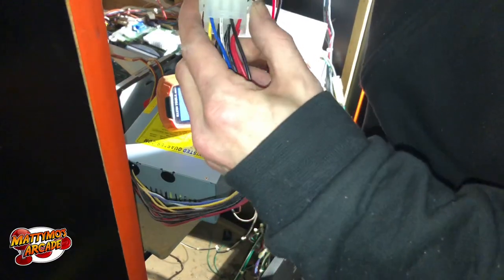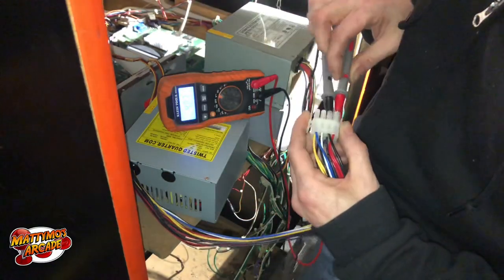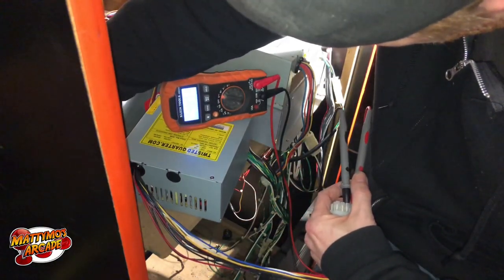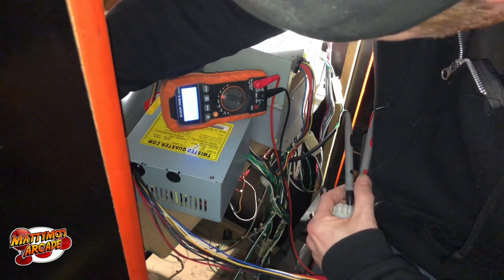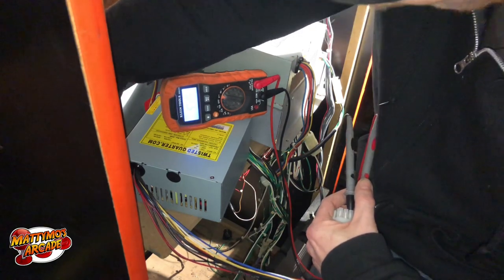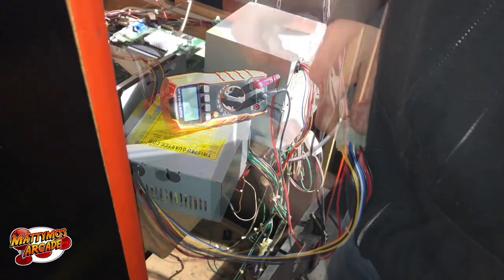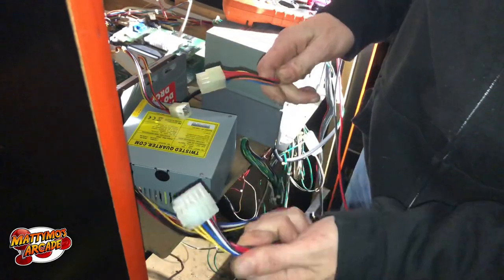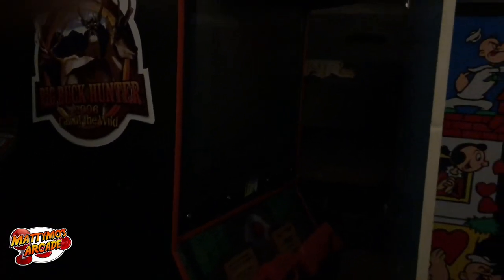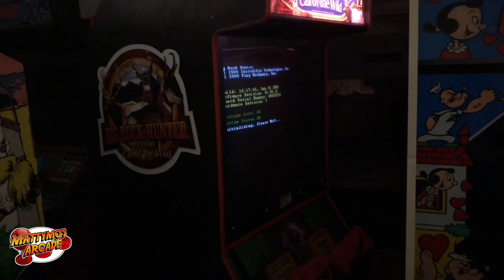Let me find the ground. Five volts is reading 4.8 — I can come up a little on that. I want it at about 5.1 — right there, perfect. Now let me plug this in and see how it works. New power supply is installed and set at 5.1 volts. This seems to be working.